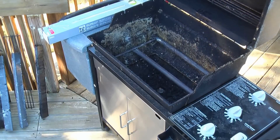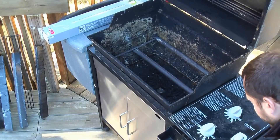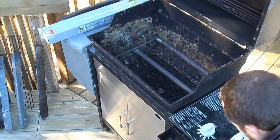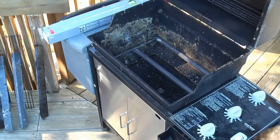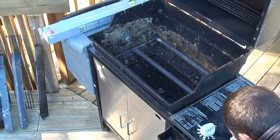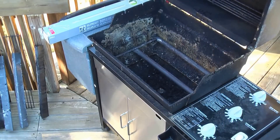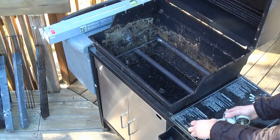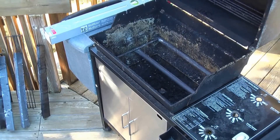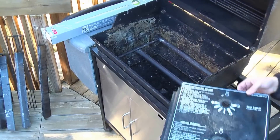Once that 7/16 bolt and these two screws with their washers are removed, the only thing holding this panel on are the three knobs, and those just pop straight off. Screw out here. So pop these knobs straight up off — this whole panel is removed freely.